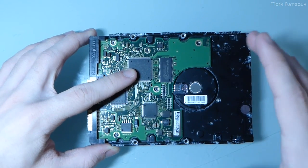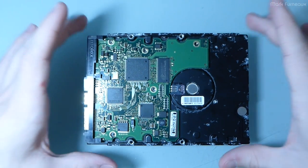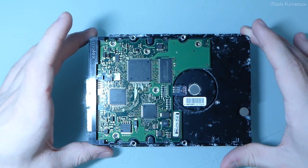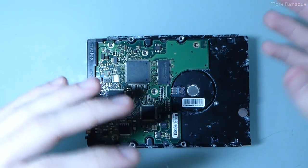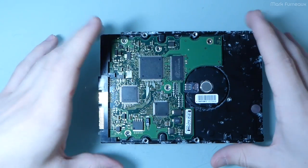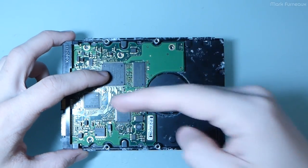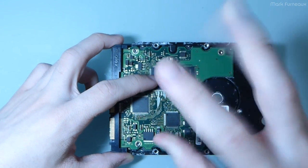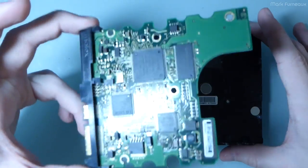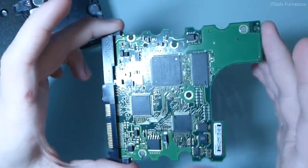And what had actually happened was the power supply on the Vantec USB 3.0 dock that this was in actually went into overcurrent protection. So effectively this thing went short circuit. I checked it, and I couldn't see what was immediately wrong. The dock was okay, and the way that the dock power supply handles overcurrent is it simply shuts off for about 2 seconds, and then it tries to restart, and if there's still overcurrent, it goes back off again. I could see the light pulse on as it tried to start, and it would immediately cut out again. So I took the drive out, and I removed the circuit board from all the mechanics, and I just inserted the circuit board into the dock, and the short was still there.